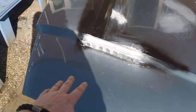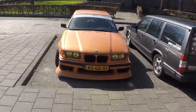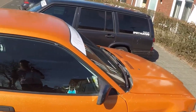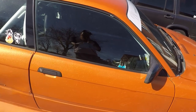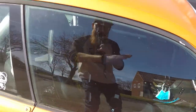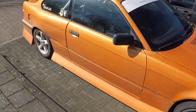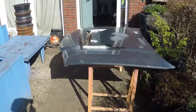This car has been used as a donor, so I also have a door and I want to change the passenger side door because the window is not working properly. The electric motor and everything is working, but the rails that the window goes into are sort of holding the window and it goes so heavy that it's constantly pulling the arms out. The electric window has a sort of scissor motion and they break out every time. I have new clips and everything but it doesn't work, so the simplest way is I'm just gonna swap the door and rewrap it.